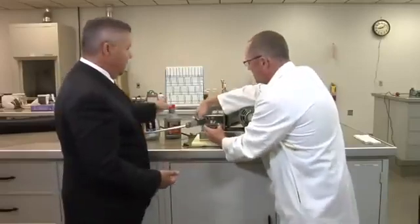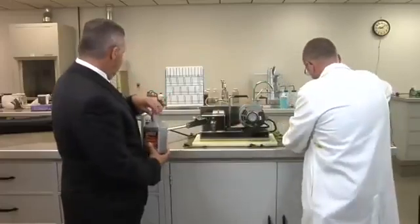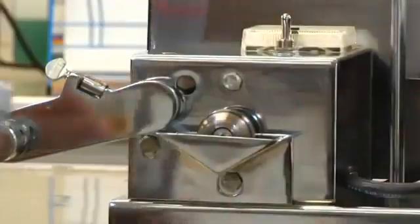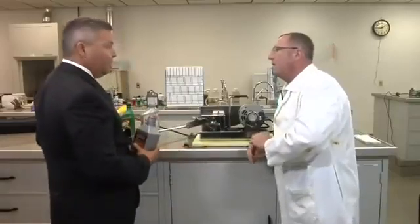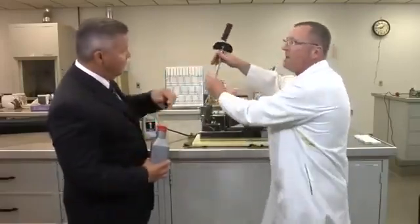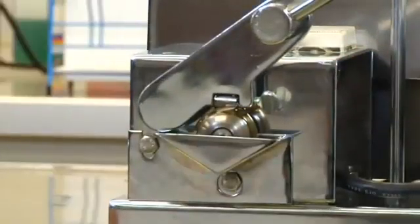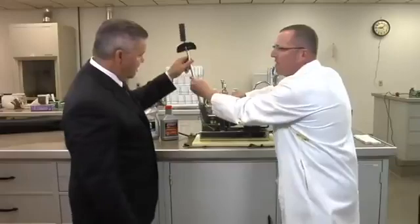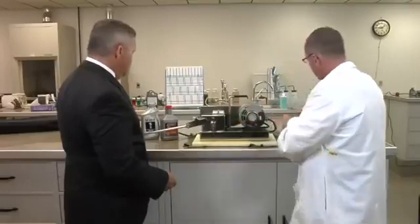Now, is that good, bad, indifferent? Let's demonstrate — why don't you pick another oil and we'll empty out the Mobil. We'll put AMSOIL in there. That one was at about 40 pounds — just over 40 pounds. So we'll throw the AMSOIL in there. The higher the number of foot-pounds, the better the result. As I apply the pressure here, notice I'm going to take my time a little bit more on this one. With the AMSOIL, that came in about 50 foot-pounds. So AMSOIL is the better product — absolutely, but I want to continue demonstrating.